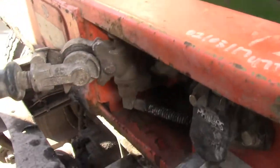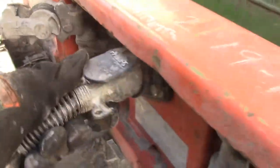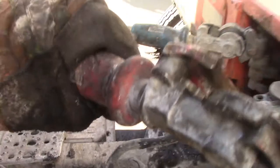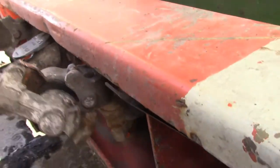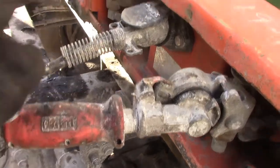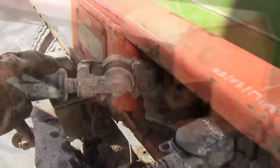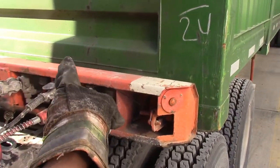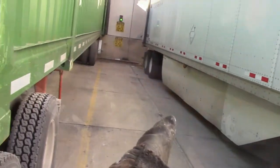Anyway, next is the lights. Next, your lights are here. Service line. It's your emergency that I pushed already in. So if you got any air leak, I'm going to find out right now while I'm already outside. Put it on like this. Emergency, electrical, service. The service line is always gonna be on this side. Emergency is always gonna be on this side, the right side.